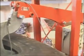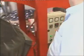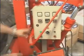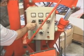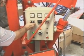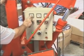It is very important that during the curing time or the vulcanizing time, the hydraulic group must be switched off by the red button. Now we connect the heating pad to the control box with the connectors provided.